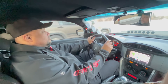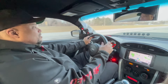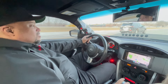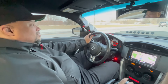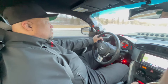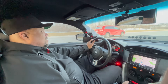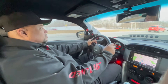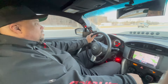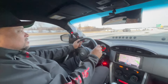The balance of this thing actually improved a little bit. From left to right it's almost a straight 50/50 balance. The front-to-rear balance is about the same as stock. The FA20 is a 400-pound motor whereas the 2AZ is 240 pounds, but then you start to add more weight once you add the turbo kit and manifold and everything. It's still definitely under 400 pounds by the time it's all said and done. Last time I corner-weighted the car, it came to a total of 2,800 pounds — that's still kind of the same as stock, full tank of gas and all fluids.